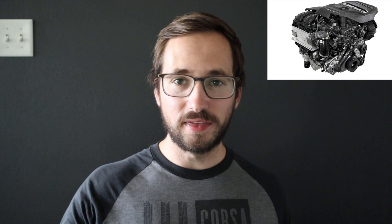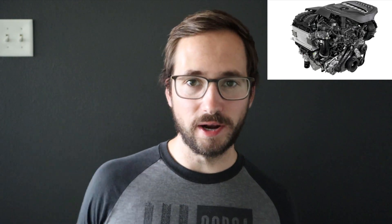On top of that, the peak torque with these turbocharged engines is typically available for a longer duration in the power band. With a naturally aspirated V8, you might have to rev it up to around 4,000 RPMs to get peak torque. But with the turbocharged engine, you might only need to get it up to around 1,500 RPMs to reach peak torque, and then that could last until 4,000 or 5,000 RPMs depending on how the power band is set up. With the naturally aspirated engine, you hit peak torque and then things start dropping off.